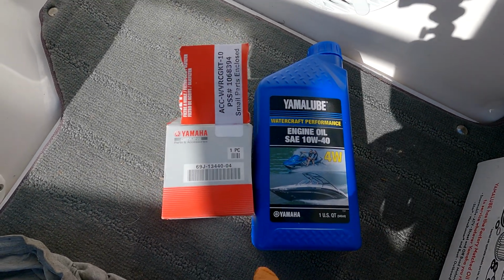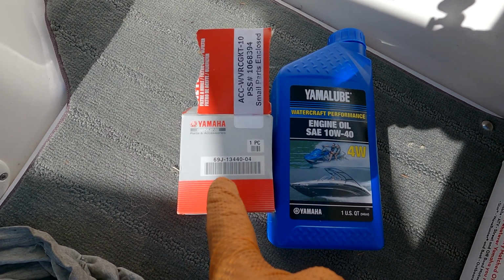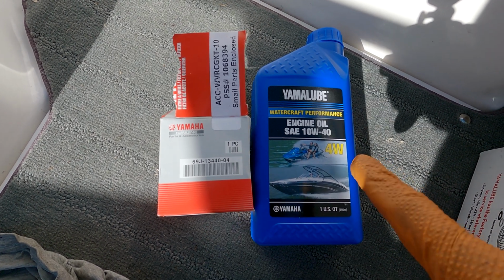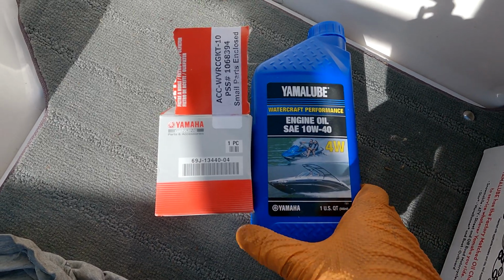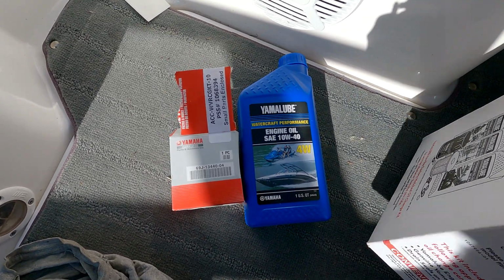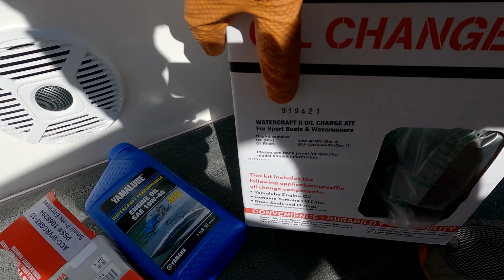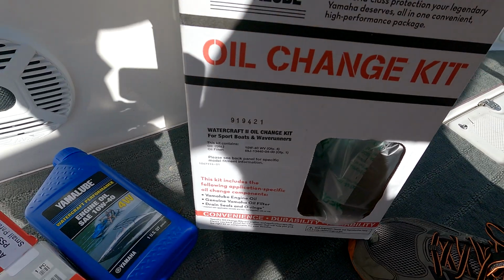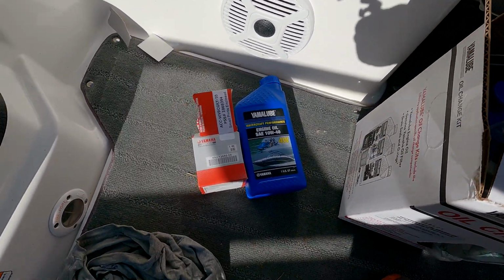Alright, so the filter that I'm using for the AR190 is a Yamaha 69J13440-04, and it takes 4 quarts of 10W40, and I'm using the Yamalube oil change kit. It is number 919421, and I'll put a link in the description below for this, as well as the oil pump.